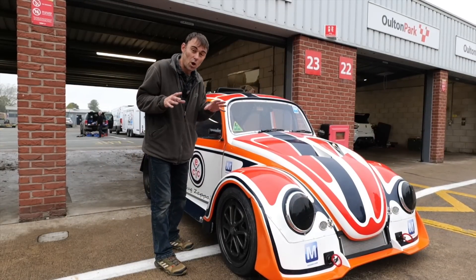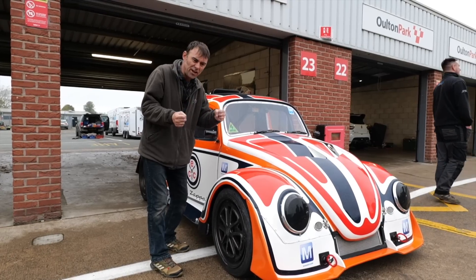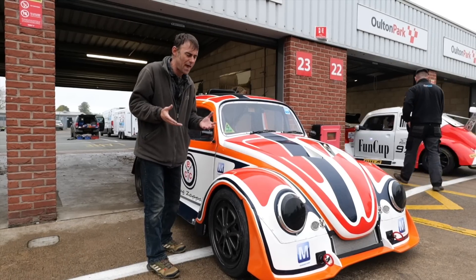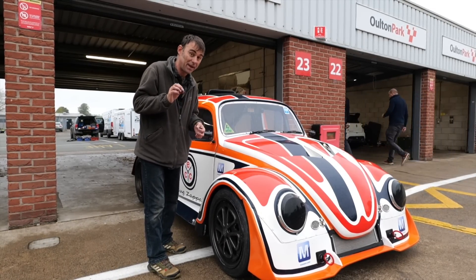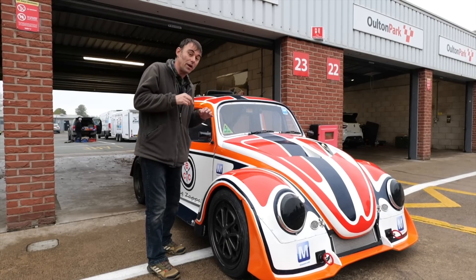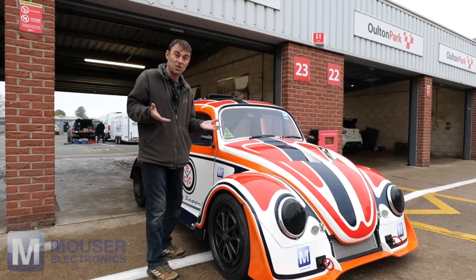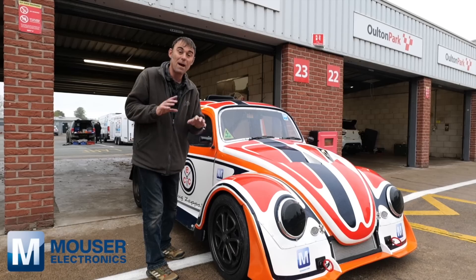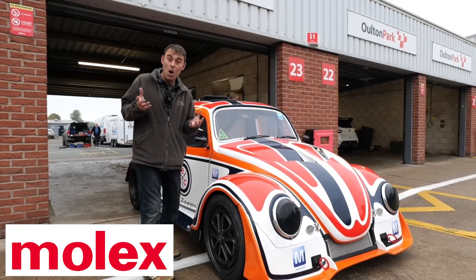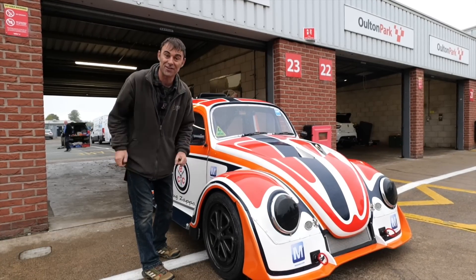In conclusion, we've got to go away and work on the power steering issue — it's getting tighter and tighter as the laps go on, so something's not right there. We also need to put a helper pump in to get the front motor as cool as the rear. Bit of work to do, but on that note — thanks to our sponsors: Mouser Electronics, go to mouser.com for all your electronics needs, and Molex, who specifically sponsored this episode. Hope you enjoyed it and we'll see you on the next one.